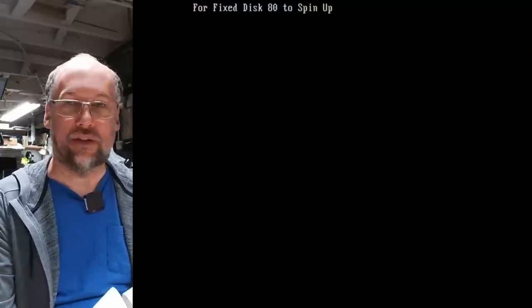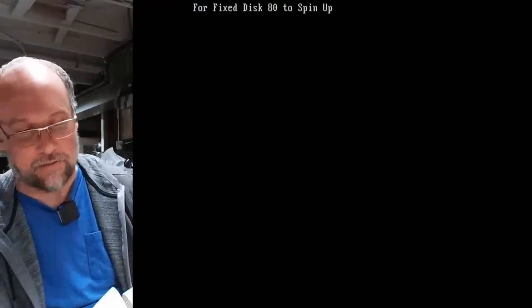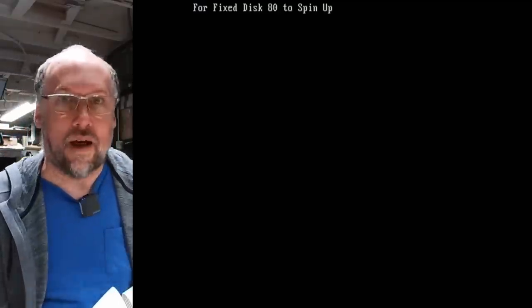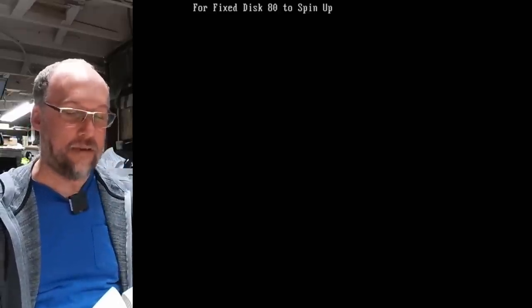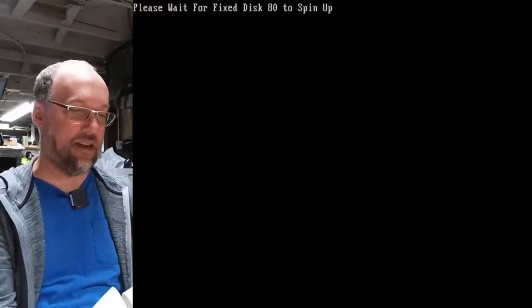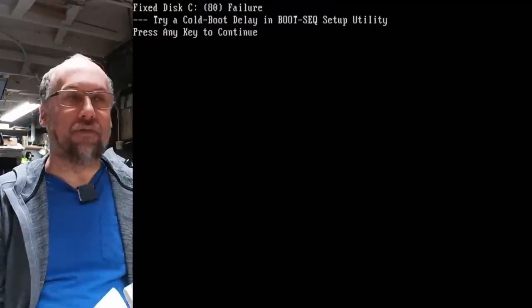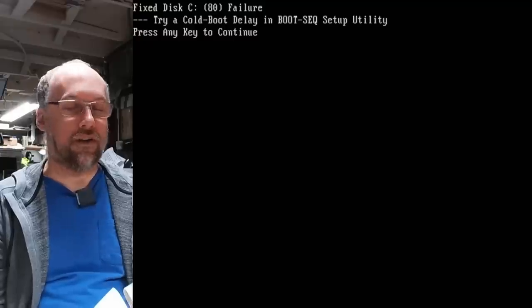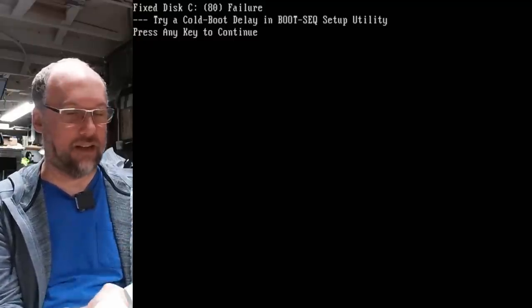All right, waiting for the drive to spin up, so at least it sees that there's a drive there, I guess. Well, the drive is spun up and it's not even attempting to access. So I think this drive is bad as well. And unfortunately, we have the same old hard disk failure. I'm gonna go look up the heads and cylinders though, just in case that somehow makes a difference. It really shouldn't though. And let's see what happens.